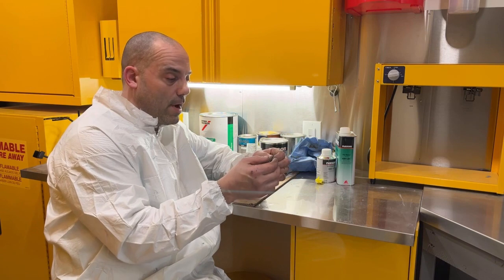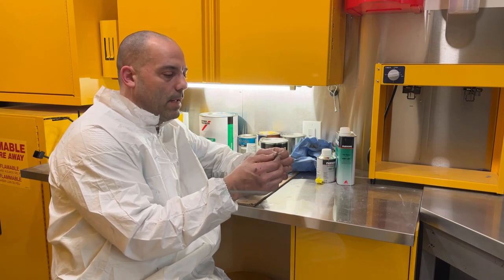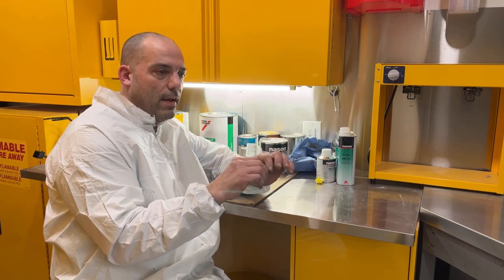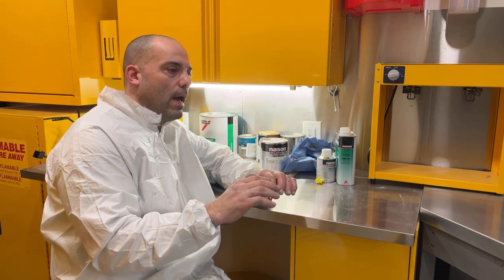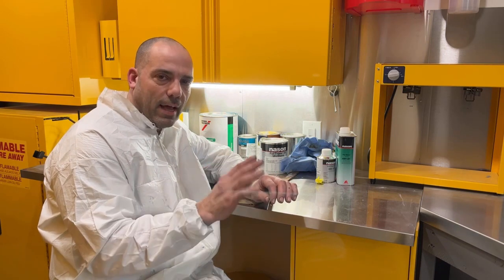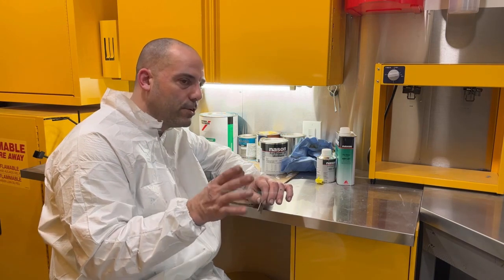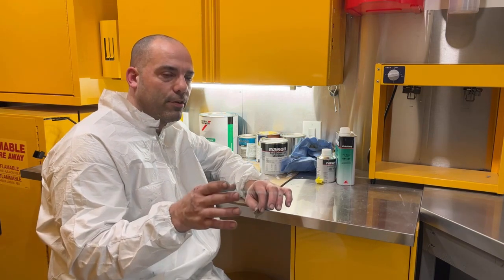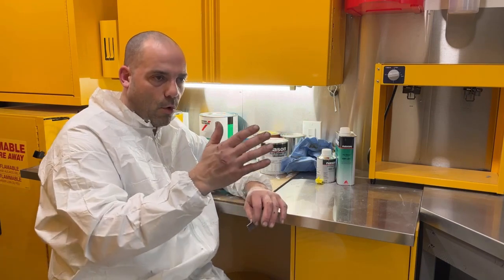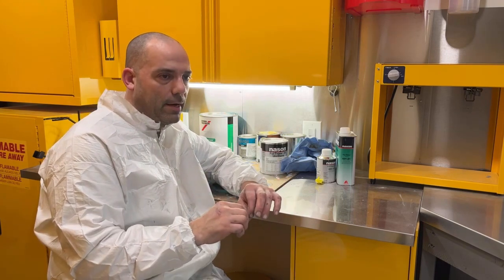I've never actually tried it, maybe once. But I'm going to tape off the ends here and the handle, and we'll try to scrape it down just to get it even with the clear around it. And then if I can do that pretty successfully, I shouldn't have any problem wet sanding and buffing it out. Not too concerned about it. If I do have to fix it, I'll just have to blend the color right there and then reshoot the quarter from the top down, which won't be a big deal.